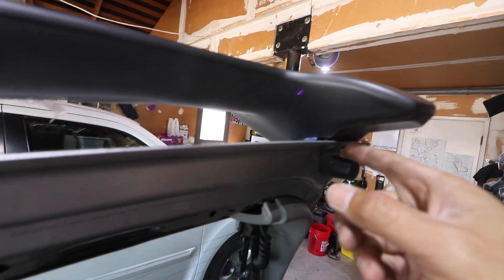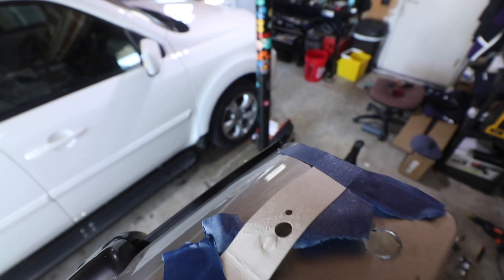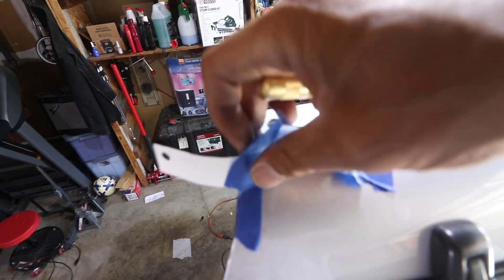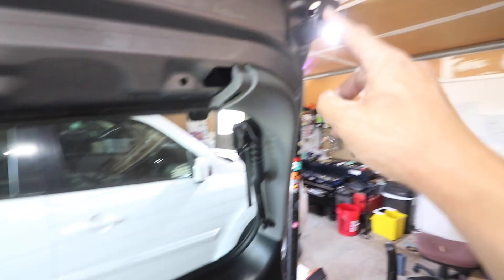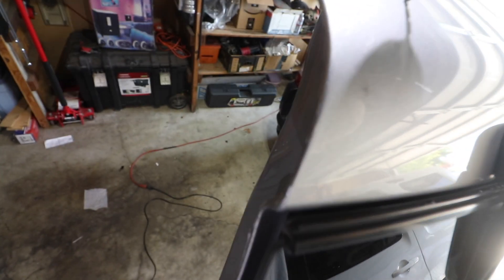The wire hole is for our power wire to run through here and down to splice it to the brake light. We gently remove the spoiler — there it is. Now all we gotta do is drill a hole there so the wire can go through. The punch tool creates an indentation, leaving a mark. Once we take the tape off, you can see a small mark — that's where we need to drill. This rubber piece unscrews — it's threaded — and once it goes all the way out it just pulls off. Then line up the bit so it doesn't go crazy.